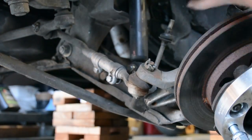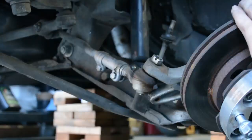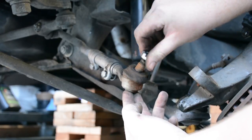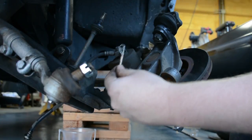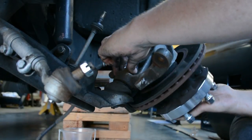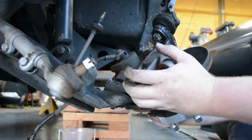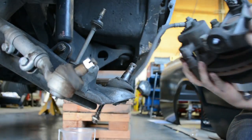Next is trying to get the spindle off, so we need to take out all the cotter pins from whatever is attaching. This is our steering linkage, so we'll get that undone. I like to put the nuts back on everything so I don't lose stuff — or just put them in a bag, your choice. Take the cotter pin out of the lower ball joint. My spindles were really easy to get off; a couple of light taps on the threads and they pulled right off. Other times you'll have to use a pickle fork.